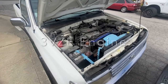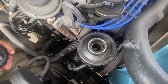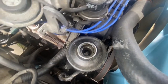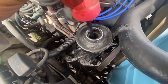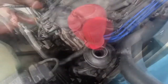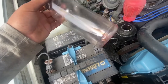Just so you're aware, this is a 1993 Toyota T100 with a 3VZE motor. First, I'm going to open up the cap and check inside. You can see the reservoir is pretty much halfway down from what it should be. I'm going to remove all the old power steering fluid out of the reservoir using a turkey baster to suck it all up and put it in this bottle to show you how dirty it probably is.